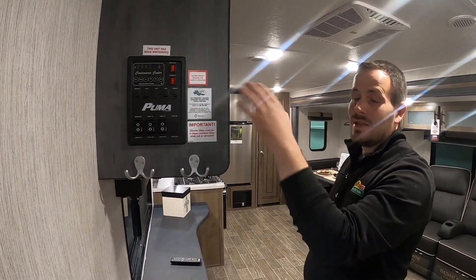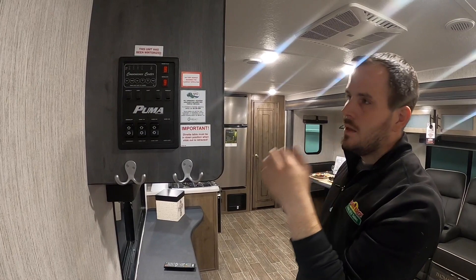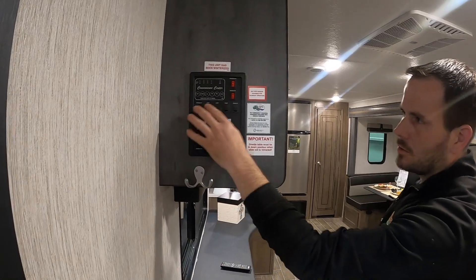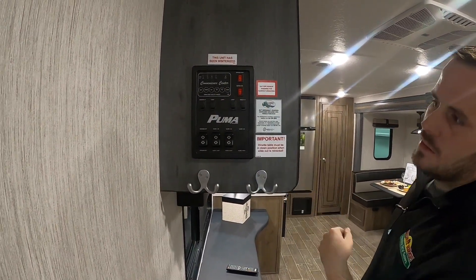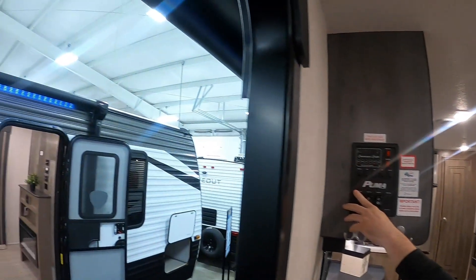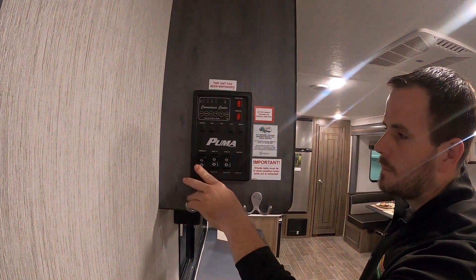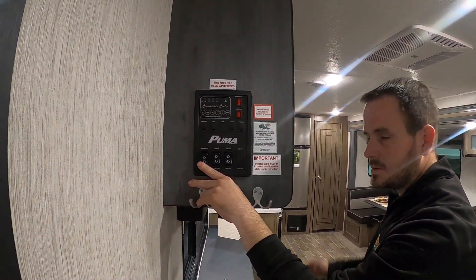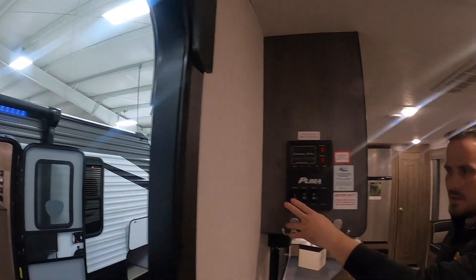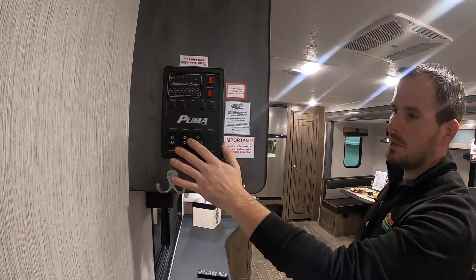This unit doesn't have an electric switch on the inside for the water heater — it's only the one on the outside. Switches in here are all for lights: awning lights, light one, light two, porch lights. Then you have your awning extend and retract — really simple, just extend it out as far as you can. If you're stuck against a tree, you can stop it. When you bring it back in, bring it all the way in until it snugs up. Make sure if bad weather, rain, or wind is coming, you get that rolled in — wind will take those awnings off, it acts as one big parachute. Then you have your slide controls, which are simple in-and-out mechanisms.